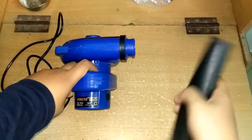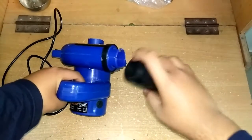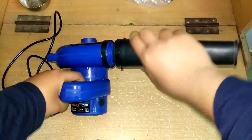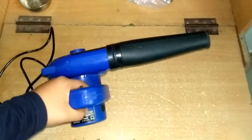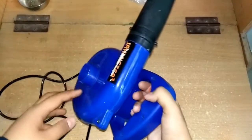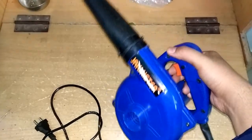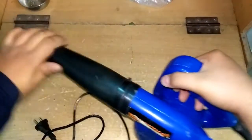This is the attachment that fits right on the top of the blower — it has these two locking pins. It's not of very great quality, but it's working for me. The blower will suck air in through this vent over here and then blow the air out. This type of blower is called a centrifugal blower, because it uses centrifugal forces to push the air out of the mouth of the blower.